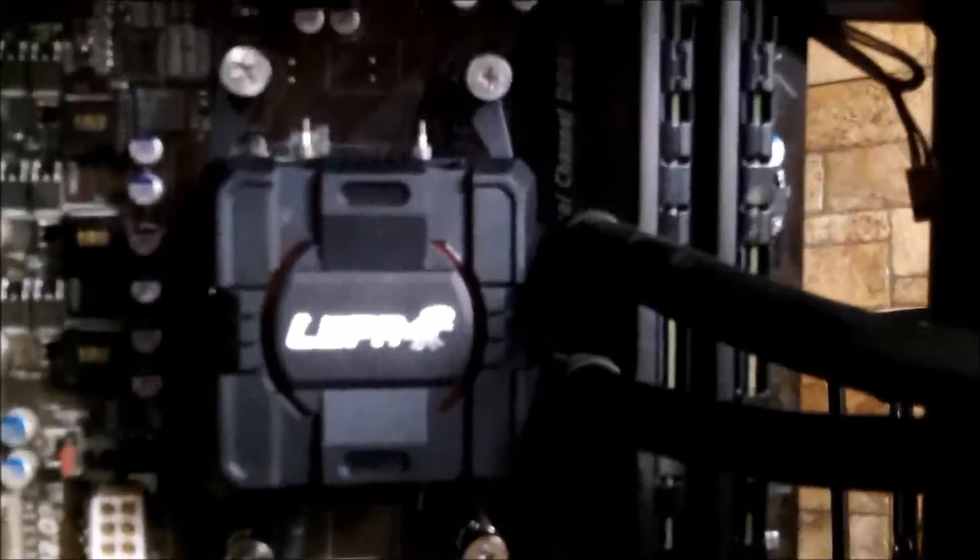I'm going to tighten this down and put the video card back in and get everything else set with the case. I got them all the way tightened down — they were not spinning in the back. You just tighten them until the bracket rests on the spacer. There's a spacer on each of the four screws.